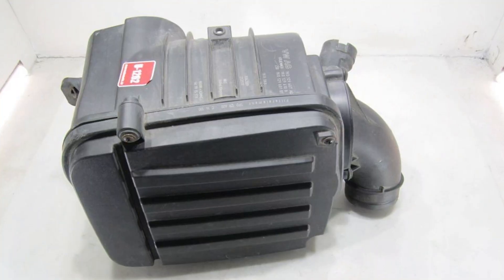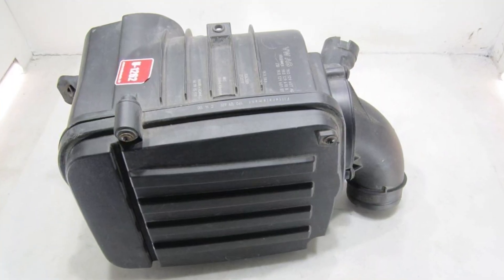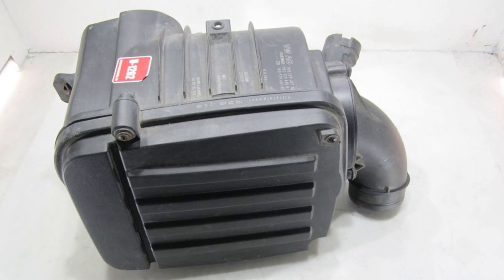The problem is that this will only change the engine sound in most cases. The plastic box that you are taking out during the process is called the resonator box. It makes your engine sound much quieter, but when you remove it and install the open cone there is nothing that can block the sound of your engine but the thin filter material.